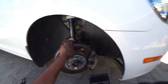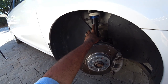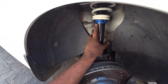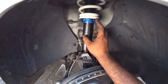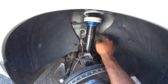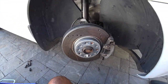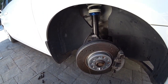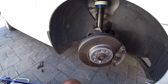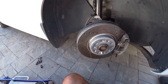I installed the new bushings and got them torqued down to spec. I put the strut spanners — the locking nuts — as high as I could, because right now I need height. I need to lift my car up. Once we're back from camping, I'm going to lower it back down. These coilovers sit really short compared to the factory shock.